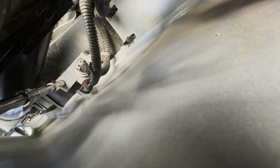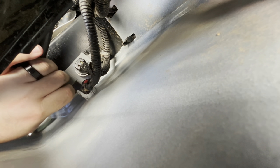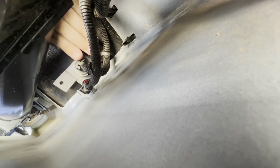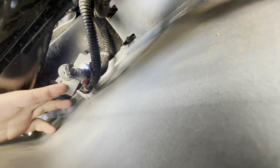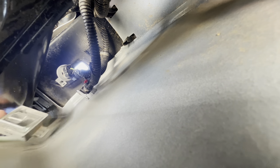I'm just twisting it. Take that out — that was the reason for all the extensions, it's really hard to get your hand back there. Take that seven millimeter bolt out. I'm able to come up top. Before I let this housing come out, I want to twist this valve out. Then just take your finger and wiggle this — it has a little slide that it comes up. Then the entire housing is out.